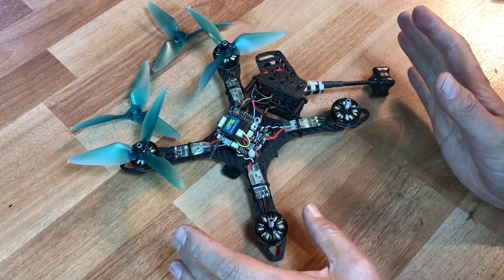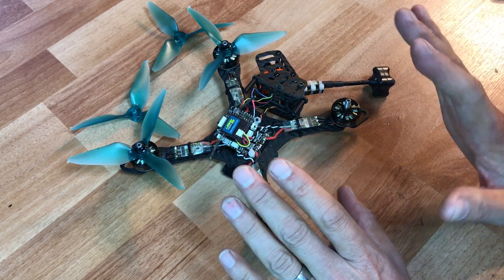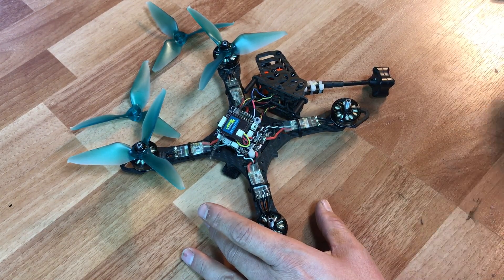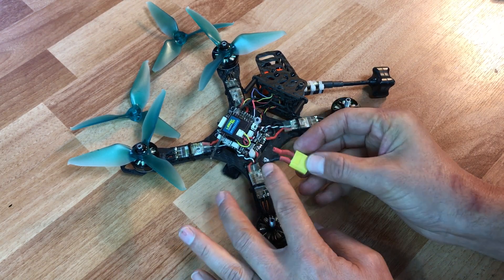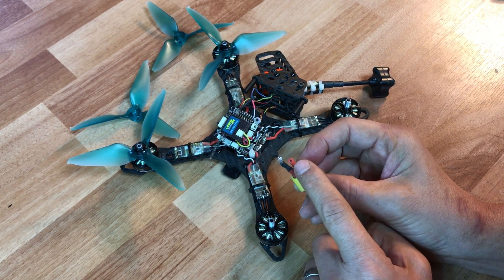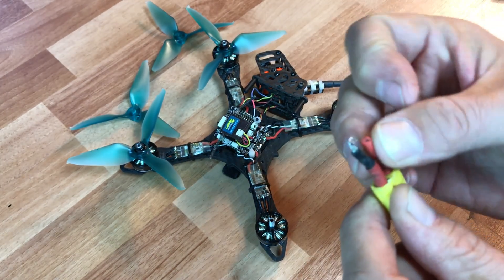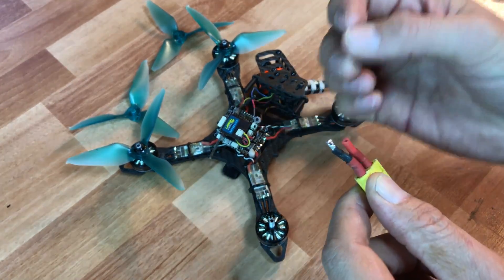So I'm going to tell you guys what actually happened. I did the first flight and I was like, wow, this is really weird. So I put another battery in and I thought I'd just fly it around and see what would happen. I got one fail-safe, and it was very perplexing. I could have sworn it was a fail-safe, but it wasn't a fail-safe. It was actually my power cable. Because this was a fairly short lead — you can see that this positive lead is really, really short. That's because there was a break in this line right here. Basically there was just a leftover nub left on my board, and it was making intermittent contact.